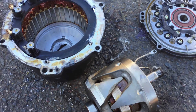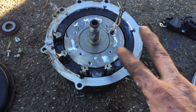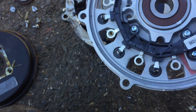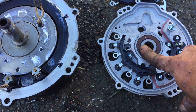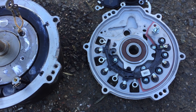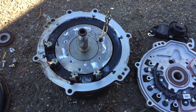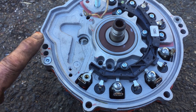Clean up real good around here — just spray a little bit of parts cleaner on a rag and wipe it off; don't spray it everywhere or it'll get all down inside. Then put a thin coat of form-a-gasket on here, just a thin coat to help the seal a little bit, and place this back on top. The wires have to go through the hole where the nut is, and then the screws go back in. The front bearing I put my new one in — it's technically pressed in with a rubber mallet sitting on a block of wood with a little tap. If you have a press, great; if not, you can tap it in. The back one definitely has to be pressed in.